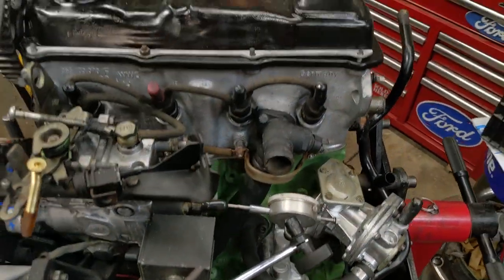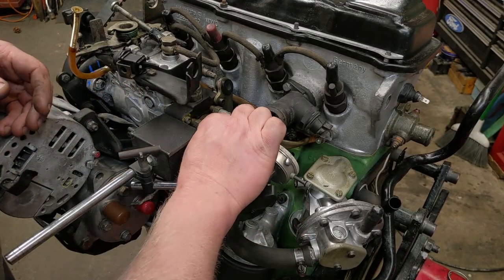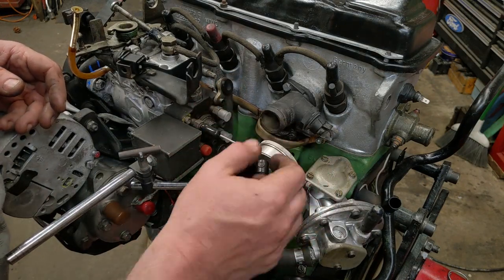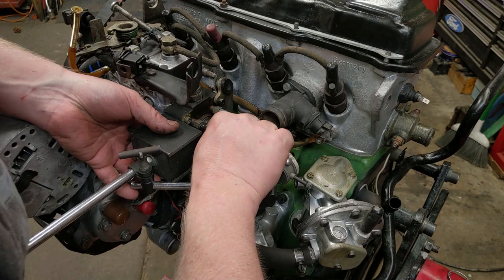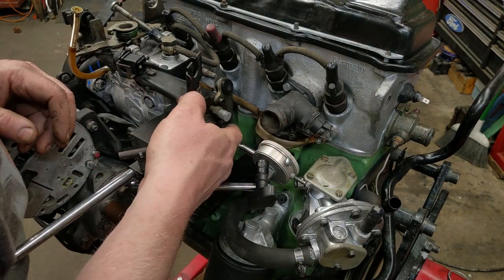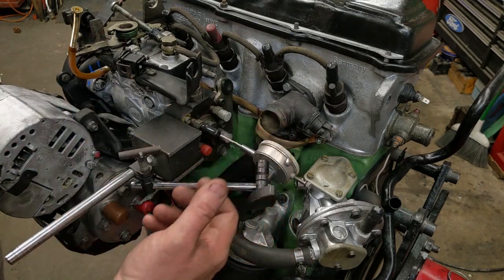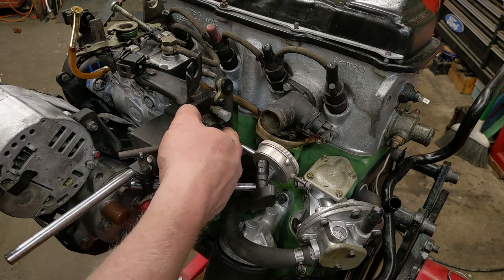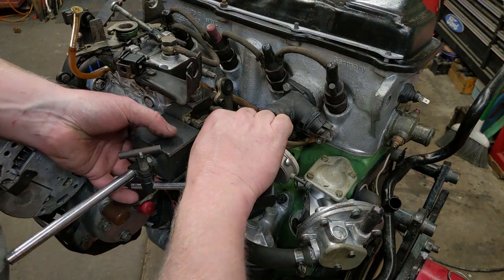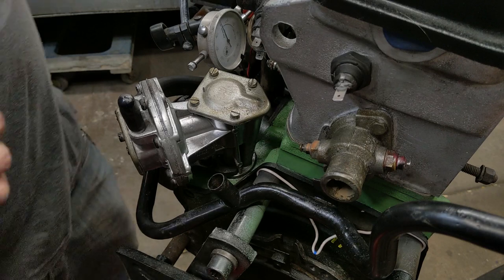What I did was, this actually requires a special tool, but it's essentially just a dial indicator that pushes on the center of the injection pump. So I just took a dial indicator and took out the little screw-in tip, and I set a piece of copper wire in there, like household 14 gauge, but left a little plastic sheath on it, and put my magnetic base, and I'll just magnet it right to the side of the injection pump. Normally you do this in the car,